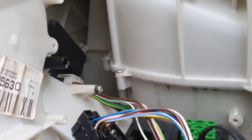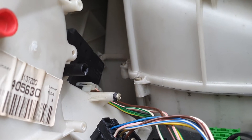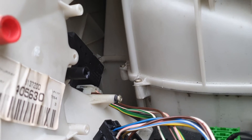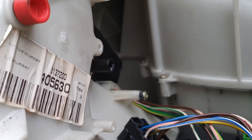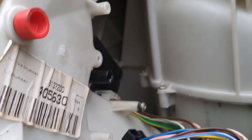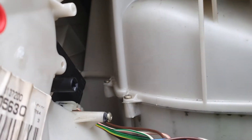On this side down here there's actually a little shaft that comes out to control the foot or the face — basically opens up a duct for the feet. On mine that little shaft is split, so even if the actuator is good, it's split in there. So that's a pain.